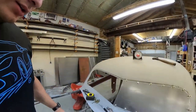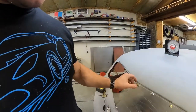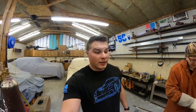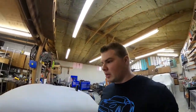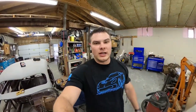We've got the windshield in — here is our temporary holding position. We still have to pop rivet these in, but we're not going to pop rivet them before we paint it. For now they're just held in by clecos, which are coming out on me, but that's at least started. Once we get it painted we can get it pop riveted in. The body is all pretty much ready to go for sandblasting — we wanted to finish this before we go on vacation this weekend.